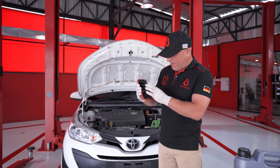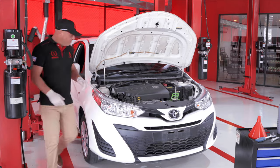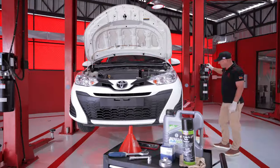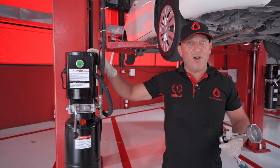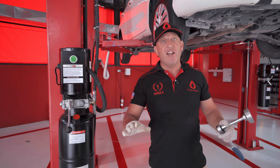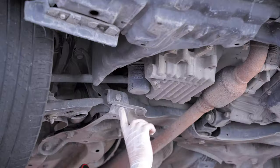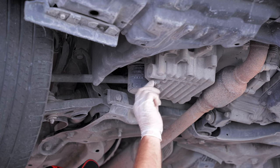Now the timer is finished. We'll turn the engine off, take off the oil cap, and get the car up in the air. We've got a professional workshop lift here — if you're doing this at home, make sure the car is really stable before you get under it. The two things we're going to look at first are the oil filter, located here, and the oil tank drain plug, located here.